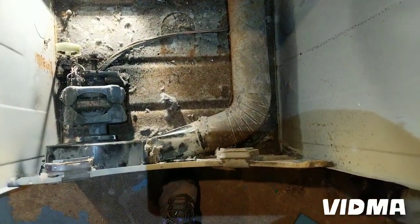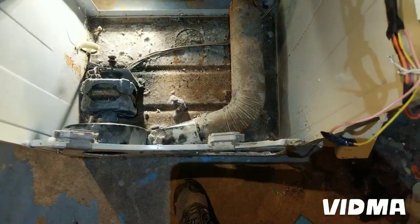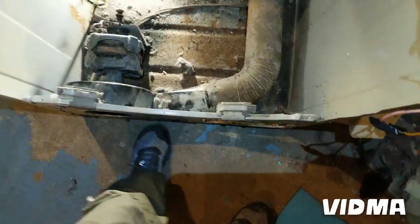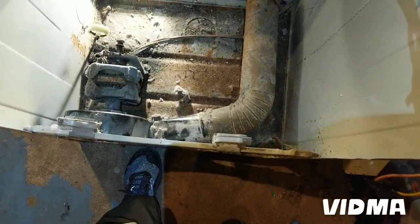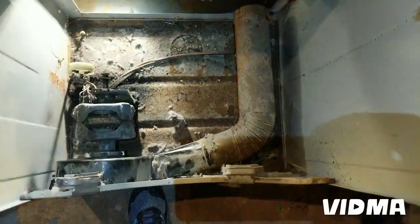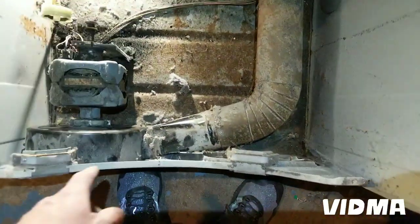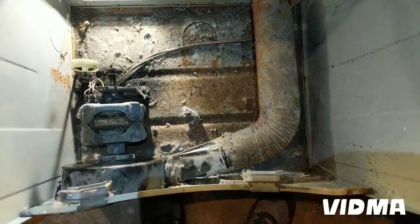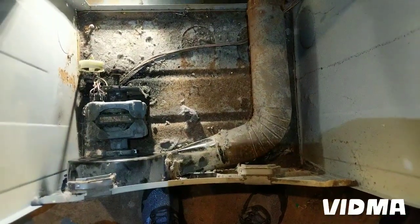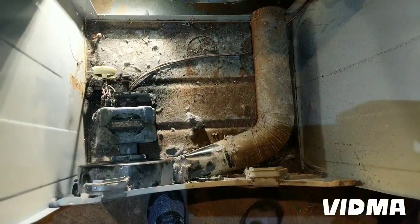So anyway, if you have this old dryer and you don't want to break your blower wheel, try not to stick it too far in, even though it's almost impossible to do on any other dryer, but this one is designed really well. It has very good airflow, so this really helps to get the air out of the dryer. For commercial, I understand you need that. So anyway, probably there are some other dryers designed that way, but I hope that saves you a blower wheel.